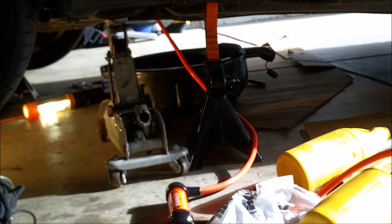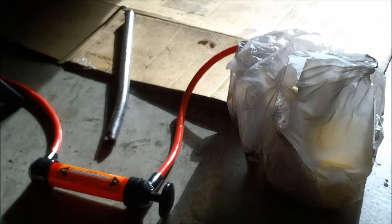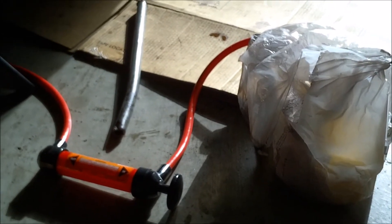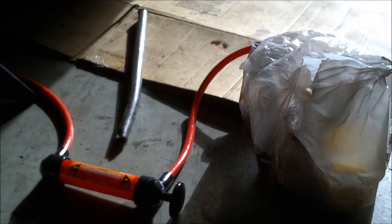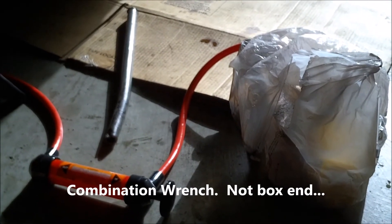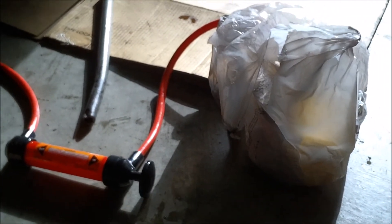It's pretty simple — not much of a way you can really screw this up. The only way you could is if you had the plugs reversed, and you'd know because it obviously wouldn't be working. At this point I'm all finished up. I put the drain and fill plugs back in. You can check your manual for torque specs on the bottom one. I couldn't get my torque wrench in there — couldn't even get a socket wrench — that's why I had to use a 15/16 regular box end wrench.